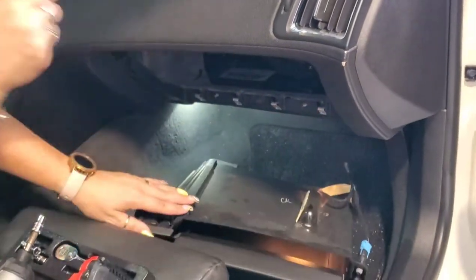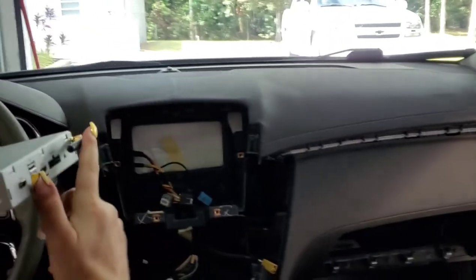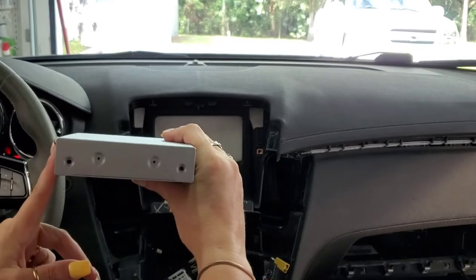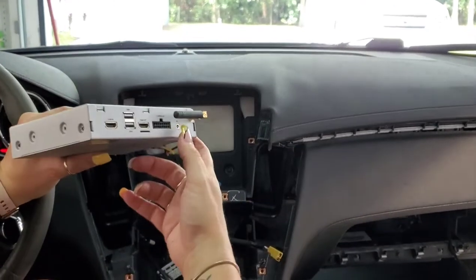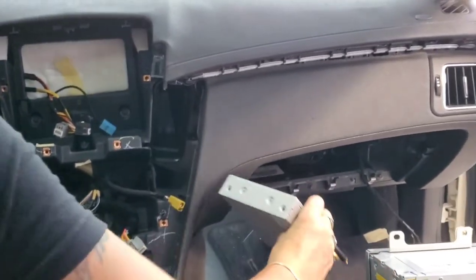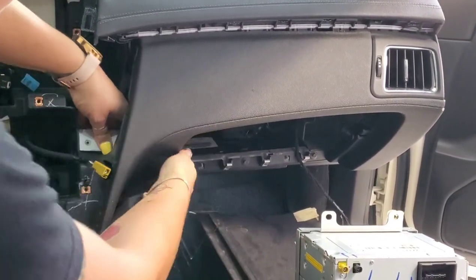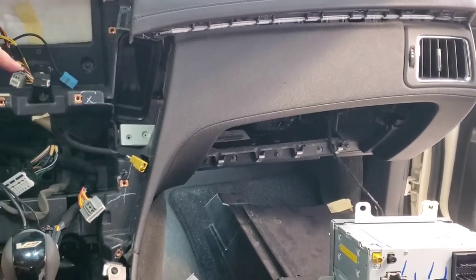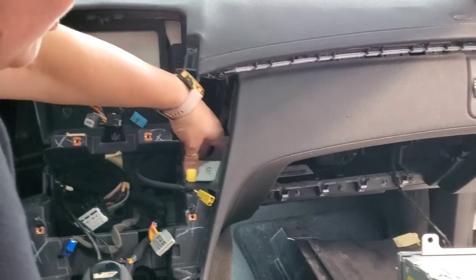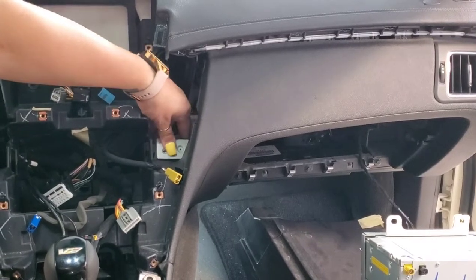Now you have access for running your wires. The manufacturer's instructions are always asking for the antenna to be in the passenger-facing position, with your ports for your wiring harness facing your stereo compartment and your access ports easily accessible for future updates. We found we can slide it right up inside here — it makes clearance on everything including our dash panels and is easy to access with our harness. You're going to want to secure it with Velcro, double-sided tape, or the mounting brackets that come with the kit so it doesn't move when you're moving the car.